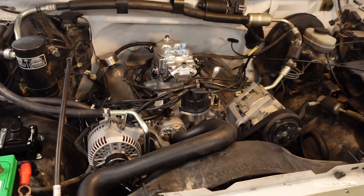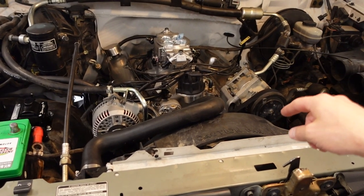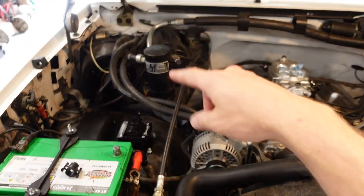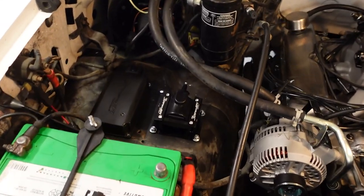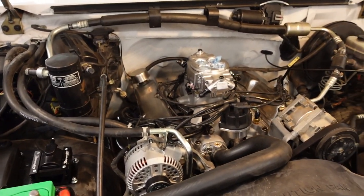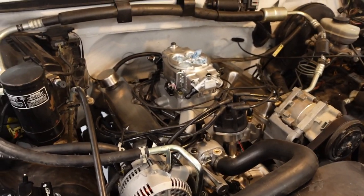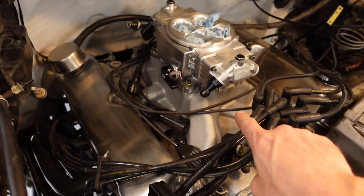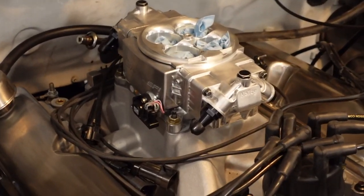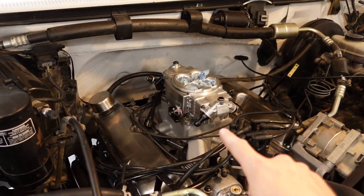This looks a little different from the last time you guys saw it. We've got the cooling system complete — the fan shroud, cooling hoses, serpentine belt in place, plug wires are on, heater core lines on, and the Hyper Spark CDI box and coil are installed under the fender well. We are really just some wiring and fuel lines away from firing this thing up. I am waiting on a regulator — Holley has a special one that attaches to the front of the Super Sniper with a built-in regulator on the back, which is really trick. I think they said it'll ship at the end of the month.